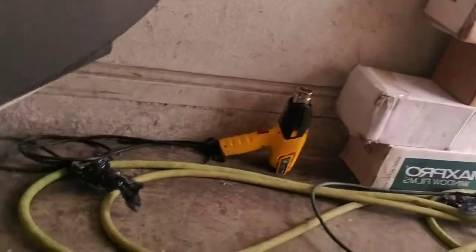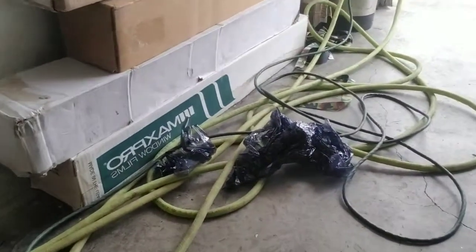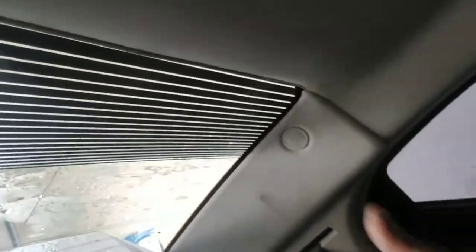It's actually coming off in layers. The first layer turned purple — there's a little piece of scrap right there, that's the old purple part that came off first. Right now I'm trying to get off the clear layer. As you can see, it's starting to peel slowly. Basically what I do with the steamer, I just take it and put it in the area I want to start peeling first and just let it hover in the area for about a minute or so. This steamer gets pretty hot. Depending on how long the old film has been on there is how long you want to leave it hovering before you start peeling, or whenever you start seeing it fall by itself — that means it's ready to be peeled off.